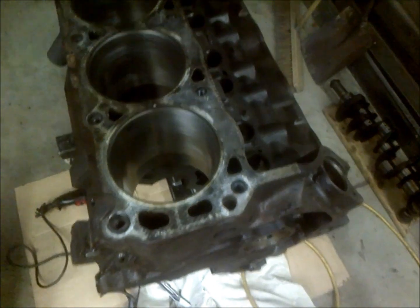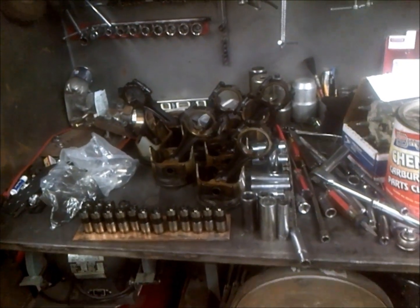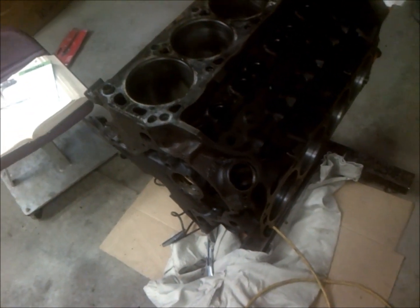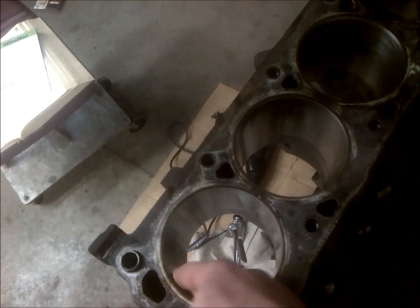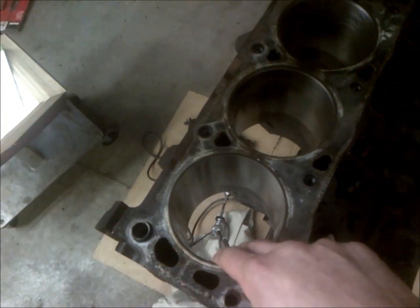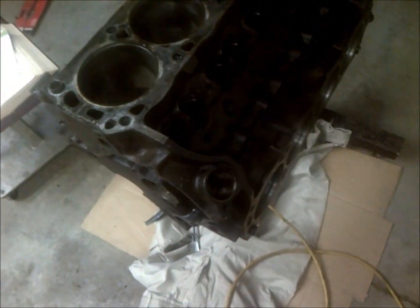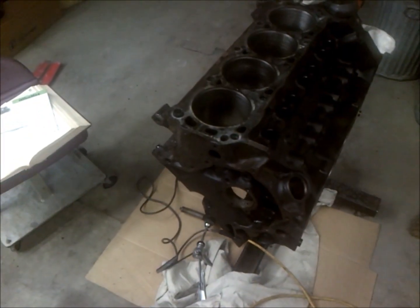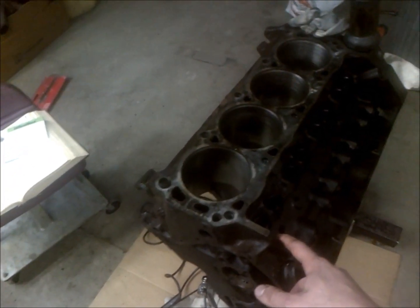That gives you cylinder walls you can use again. If you're going to reuse your pistons, check all your tolerances and clearances and make sure everything is within spec before reinstalling. Your bore has to be within clearance to your pistons or you cannot reuse them. After honing, go in with soapy water or something similar to get all the honed debris out. I usually boil my blocks — so if I were to do this I would boil it after honing and then go ahead and reassemble.